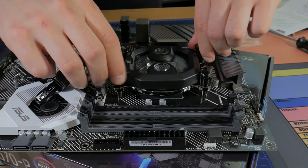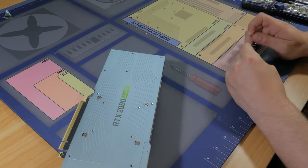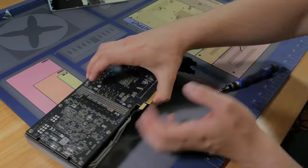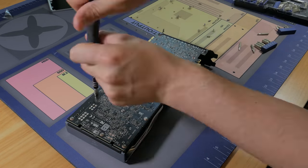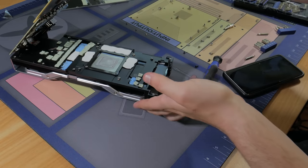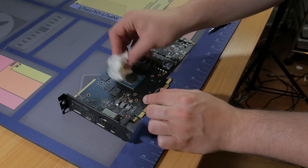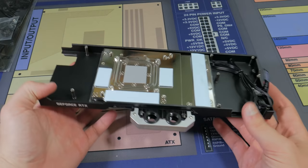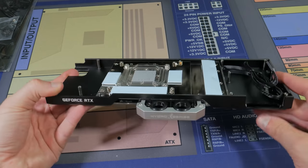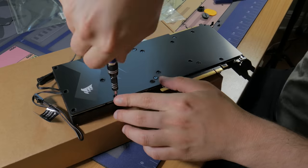You don't even need to worry about thermal paste because it comes pre-applied. Moving onto the GPU block is where it got a little more complex. I needed to tear down my graphics card which has an NVIDIA Founders Edition cooler. Normally you'd need to unscrew a few screws to access the card's PCB, but NVIDIA being NVIDIA, they made it so I needed to unscrew over 30 screws to access the PCB. Once all the screws were removed, I could open up the card, take off the leftover thermal pads, and clean off the GPU die itself. The Corsair XG7 water block had pre-applied thermal paste and pre-installed thermal pads, which made the process easier. I lowered the card onto the block and the backplate onto the card and secured it with about a dozen screws.